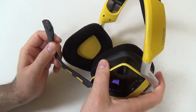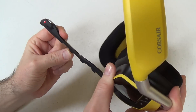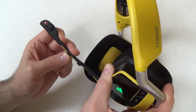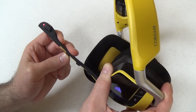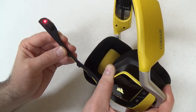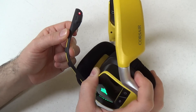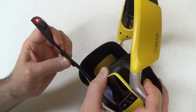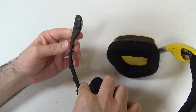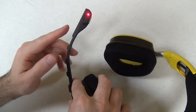Many people have had issues with the volume of this headset, including me, and that's due to another design flaw with the microphone. By default the microphone is pointed straight and it's just too far away from your mouth to properly pick up sound. It's a noise-cancelling microphone, so it will pick up your voice, but it picks it up very quietly by default. I was able to compensate for that by boosting the audio through the Corsair Utility Engine and the program I use for streaming, XSplit. But I shouldn't have to do that. The workaround is that you can bend the microphone inward somewhat — it's very stiff, there is a stiff wire in here, but it can be bent inward. And that's what you have to do if you're going to buy this headset and use the microphone. You just need to give it a nice bend so it faces at the right angle, and it will be able to pick up your voice properly.